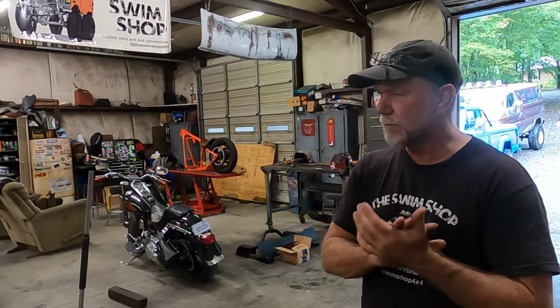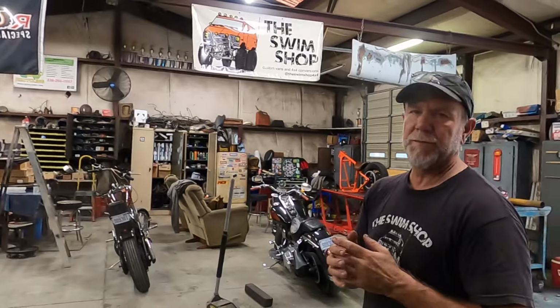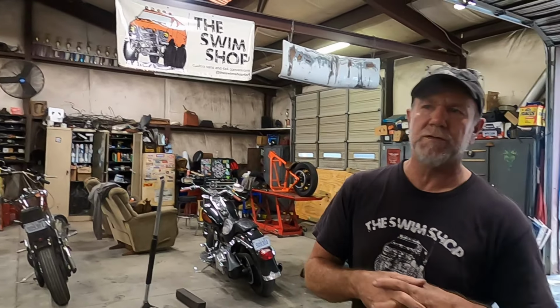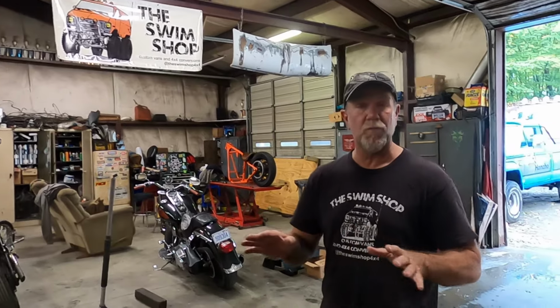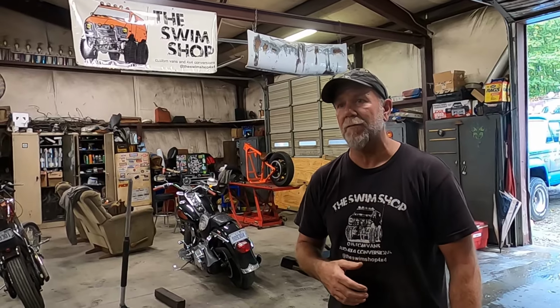We had a little hiccup on the transmission, but we changed the fluid, changed the filter. Perfect now, changed the modulator valve. So we feel good about pulling Seth's van up to Pittsburgh with it, and we're going to document that whole thing. The Glory Day show is an awesome bike show. Seth's van will be right smack dab in the middle of it with all those bikes around it. So we're looking forward to that, and I hope it'll be some good content for y'all.